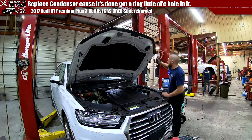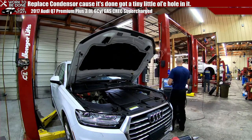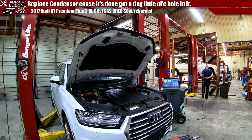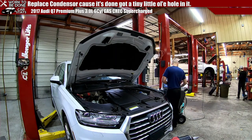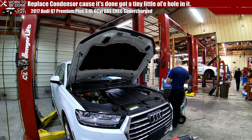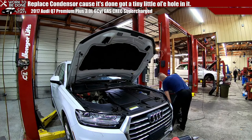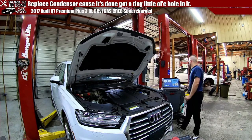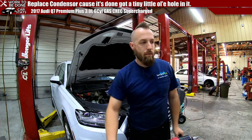All right, what was it? I know it was 950 grams, which is like 2.09 pounds. Hey Jason, I have a question. Is it rusty? It's got a little bit of rust, so it's perfect. All right, charge 2 pounds because 2.09 is what the proper side is. Inject oil, yes. Let's inject a touch of oil because we already injected some oil the last time we did this. Good. Stop. Go. It'll do its thing, and then it'll beep at me.